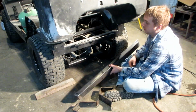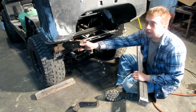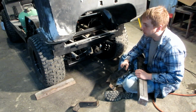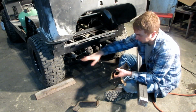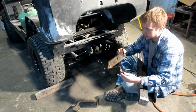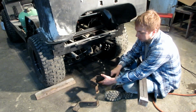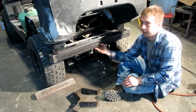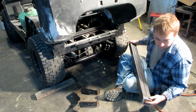All right, so for the rear bumper here. Normally, these factory mounts go way up here, because that's where the holes line up. I've decided to circumnavigate that, and we're going to put them down here on this crossbar, which is easy enough, because I just have to drill a couple holes. Then I'll put some bolts through them, whatever the size is. It looks like they're probably 3/8. Then I just have to chop them shorter and make some nice little bendy bits to attach to the actual bumper right here. Then I can put it all together, paint it black, and call it a day.